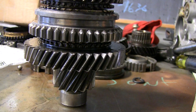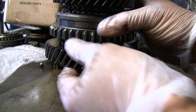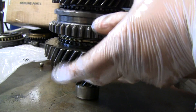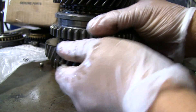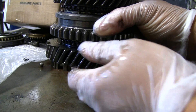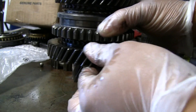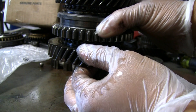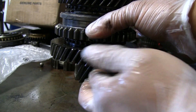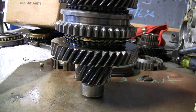What I got here is the first gear on a transmission. This is your gear spinning and this is your selector sleeve — it selects the gears for you so you can go from first to second and third. When the transmission is spinning at a thousand or so RPMs, this thing is spinning really fast. The selector gear goes down, slows it down, catches the spring, and slows it down completely. With light pressure down, I can't spin it anymore. Once it doesn't spin, it catches the gear — that's how it works.